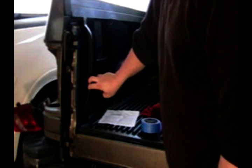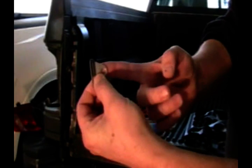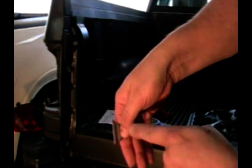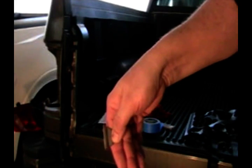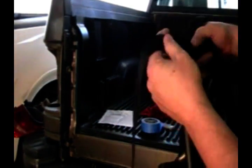I can give myself plenty of room here. The way this works: you've got these little brackets that bolt into the surface of the bed, and then there are straps on the end of the tailgate net that go through the bracket and buckle in. Here's the end of the tailgate net — it's got a strap and a buckle. The strap goes through the bracket into the buckle and you tighten it up, pulling it tight so the tailgate net doesn't flap and blow around in the wind.